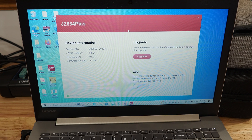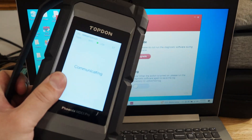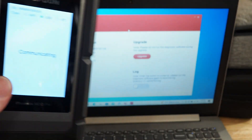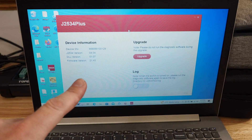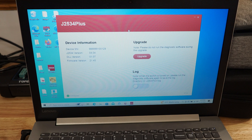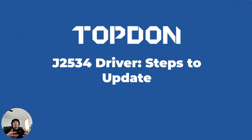So we're actually good to go. What we took you through in the process was plugging in the ethernet cable directly to the MDCI and the power cable, letting it update itself over the internet, and then checking the J2534 suite on the computer to make sure that everything is working correctly and is fully updated. Thanks for watching our video on updating the drivers for the J2534 on the MDCI.